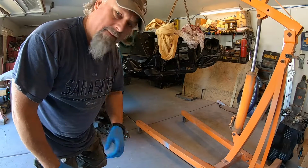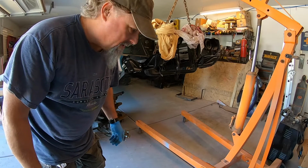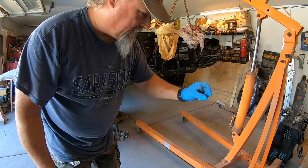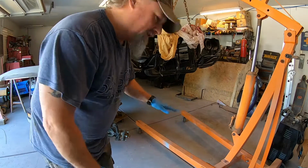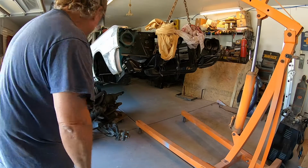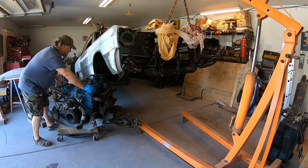Back east, in Michigan where I'm from, they pour the entire slab, and then they seal the slab as soon as it's hard enough to walk on without leaving a mark. And then they come back the next morning with a big saw, and they cut an 1/8 inch wide kerf expansion joint, an 1/8 inch wide and a certain percentage of the depth of the slab. And they cut the joints in. And if they fill up with dirt, no big deal. But it sure doesn't get stuck in them. I hate these things. Just a pain in the ass.